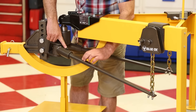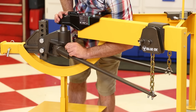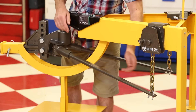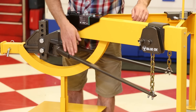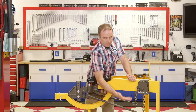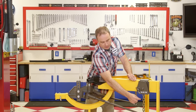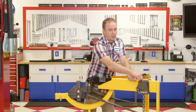Working your way back, you've got the spring bars, which are removable. There's a little latch — if you pull that up, the spring bar just pulls right out, so you can have different spring bars for different applications. The way the spring bar attaches to the trailer, you've got a chain system with a rotating latch. Rotating the latch tensions the spring bar up, and it's really easy to adjust the tension by just changing the number of links that you put into the rotating head.